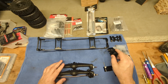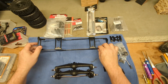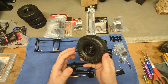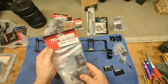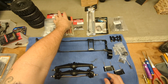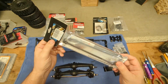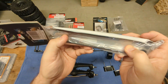We have the rest of the pieces that came with the chassis: the transmission plate, the transmission — I took it apart and put some grease in there, it's metal gear as well — screws, servo mounts, and side plates. I'm running the J-Concepts Ruptures. To stay with the lightweight theme, I'm going with plastic bead locks for now. Also have the 2660 Traxxas Big Bore shocks, mini-T springs, and the Traxxas 8361 shock caps which have metal ball ends instead of plastic. The cut-to-length driveshafts have little notches on them — you just cut them to the length you need.